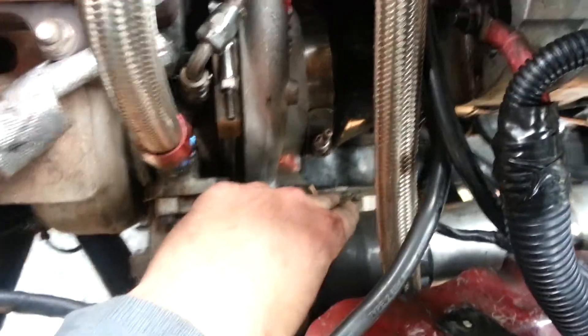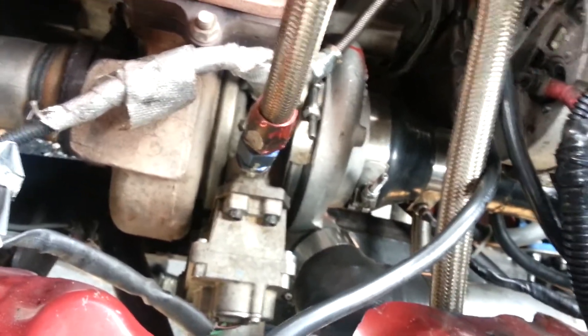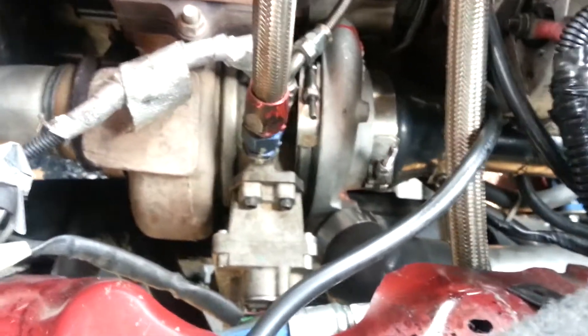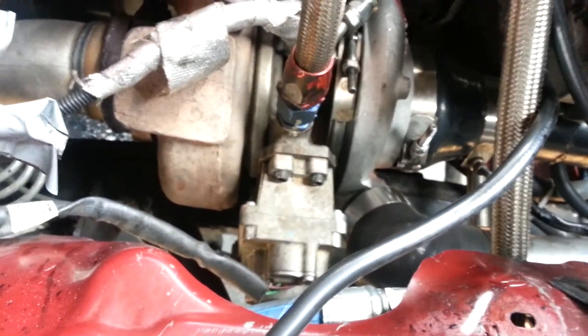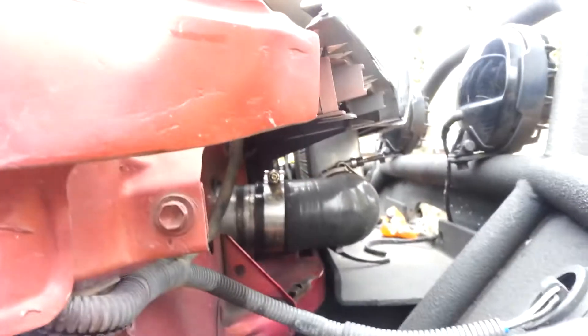What I had to do to make it fit is I ground off the flange so I can put an elbow on, and I extended my old charge pipe by four inches. As far as the housing and the diffuser and everything else, it bolts right up like it's the HE351 — really easy swap, took me probably an hour. This is where I added the extra four inches, and it goes right up front back to my intercooler.